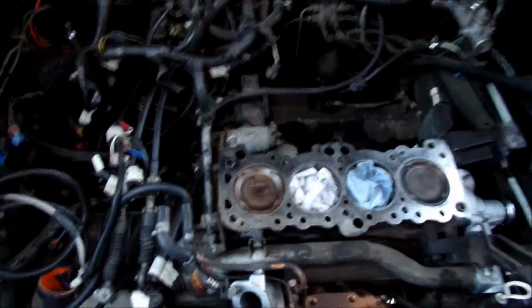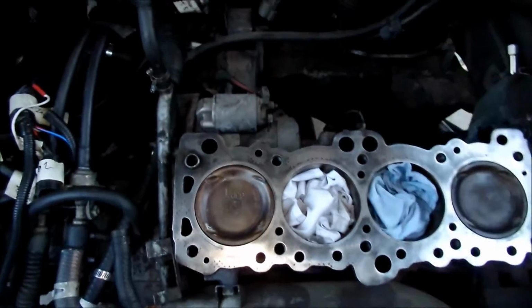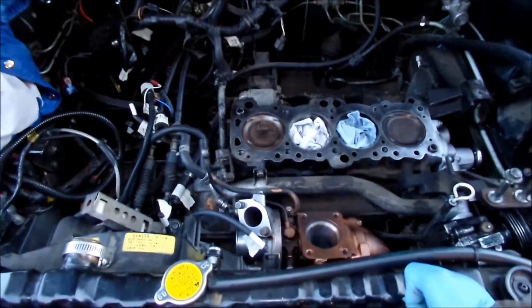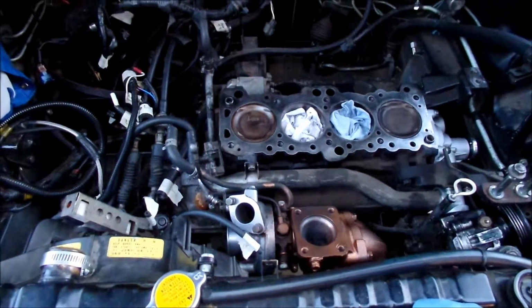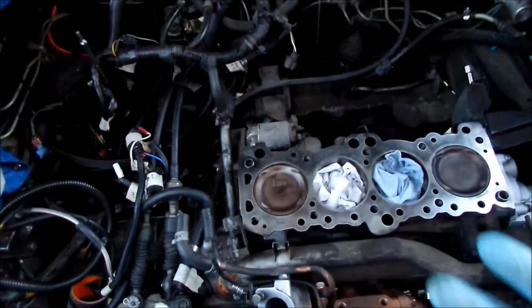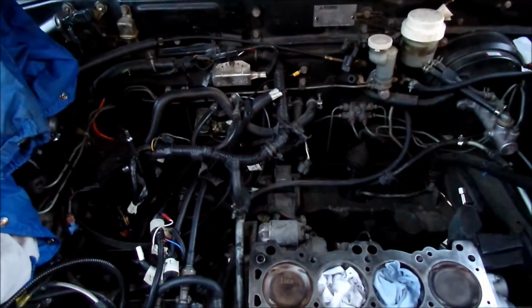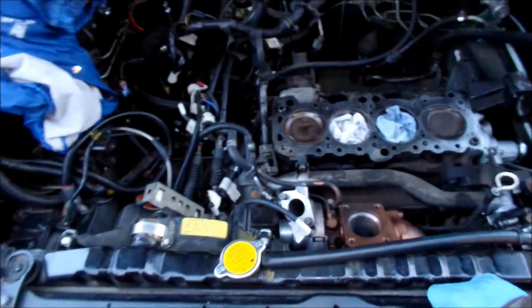But as you can see, where are the axles? Yeah, the axles are back here, so you've got your engine in front of the front axles. The car is going to have a tendency to understeer now, because you've got all this weight on the nose. The weight balance is not good. Now, of course, this is all-wheel drive, so you have an extra 100 or 200 pounds in the back of the car. So that kind of offsets it, but that's beside the point. But yeah, that's my big gripe about the 4G63.